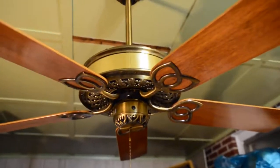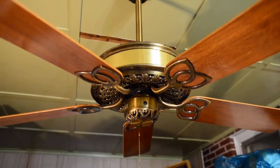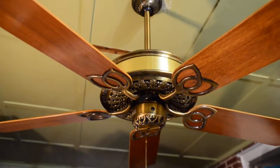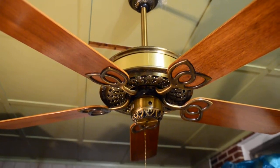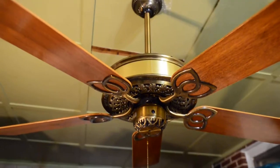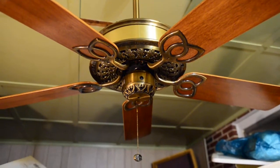When I got this fan, the flywheel was halfway broken. Which is kind of unfortunate because it was actually a replacement flywheel. This fan had been opened up in the past. And the blade irons show just a little bit of scarring from when the irons started rubbing against the top of the switch housing, but yeah. So the replacement flywheel failed. Had to put on a new one.